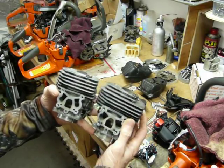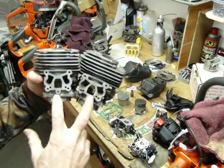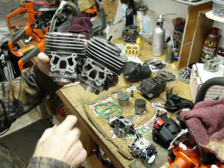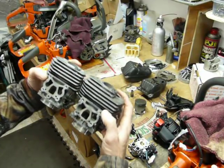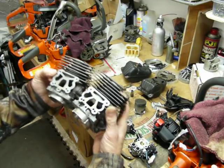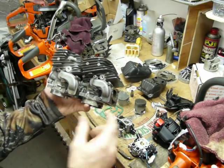If we look at the back and you see where the start of the intake circuit, they got the same basic shape, relatively close to the same shape for the fresh air circuits. They're relatively close to the same height. Flange is quite a bit bigger on the 562 though. If we look at the transfer ports themselves, same kind of concept.